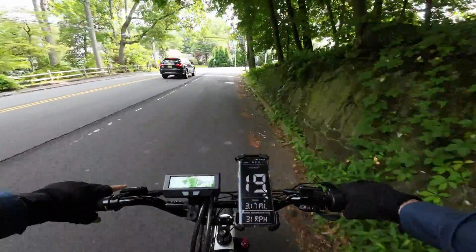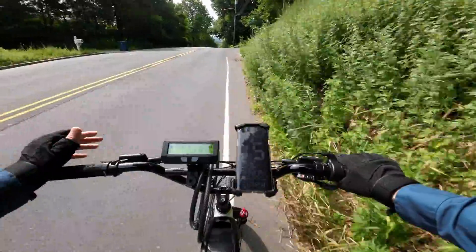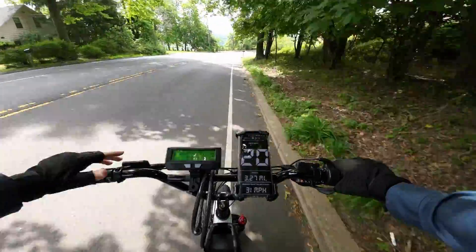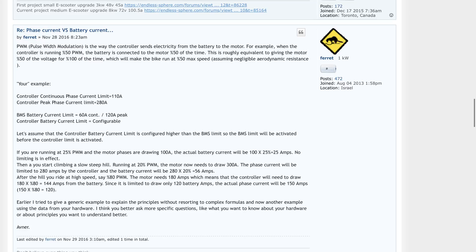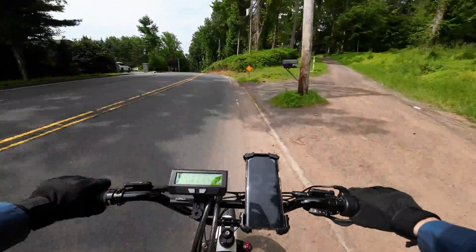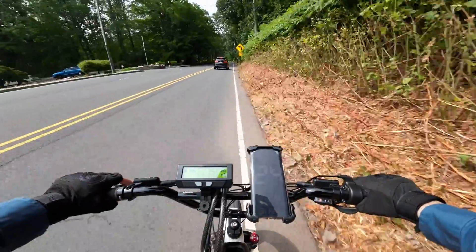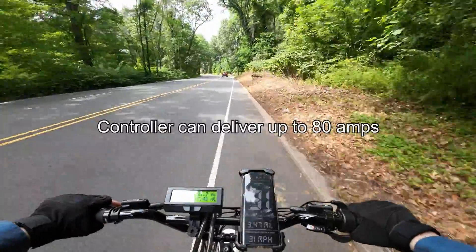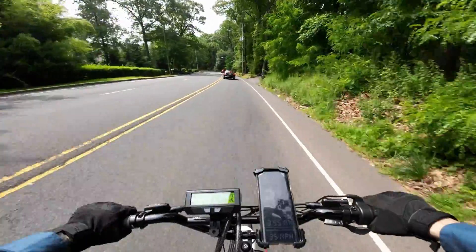So I was digging around the settings a bit more and I began to mess with the phase current. Quick disclaimer — being able to tweak all of these settings is new to me. It's a lot of fun, but I'm also kind of inexperienced with all these terms. I was doing some research trying to understand what phase current is and how it's different than battery current. I'll leave a resource linked down below that was pretty useful. I'm still not completely sure what it is — I can't explain it, I'm not qualified to do that yet. But from my testing, that's what affects the low-end torque. So I went into the settings and I upped it from the base maximum of 50 amps to a maximum of 60 amps. And now the low-end torque on this bike is adequate — it made a huge difference right where I needed it.